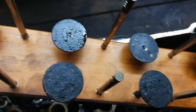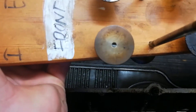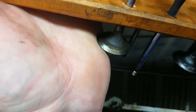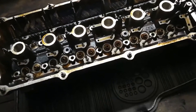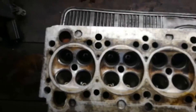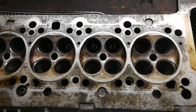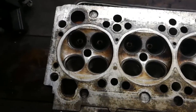You want to keep the valves as they came out of the car because they're already lapped into the head. That said, I'm going to clean them all up and relap them. The carbon deposits on these are fairly severe, so we want to get all that off. I've had a very quick go on the wire wheel with one exhaust and one intake valve and they come up real nice. Now regarding port work - if you've read online, there's not much to be had from a BMW ported head, and I might be able to explain why. This is an M52 head which was black as night in all the combustion chambers before I started.